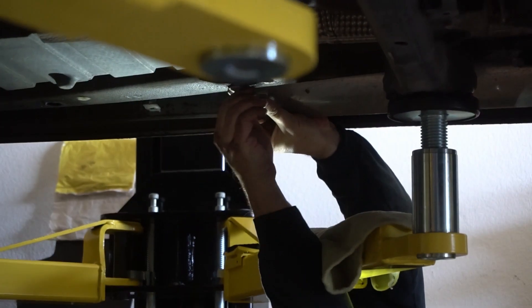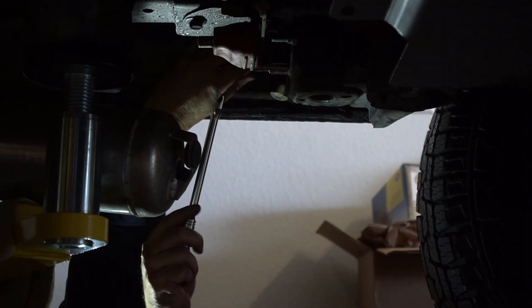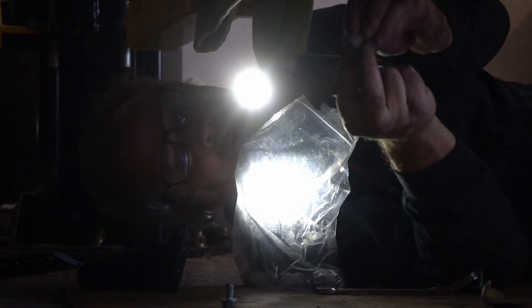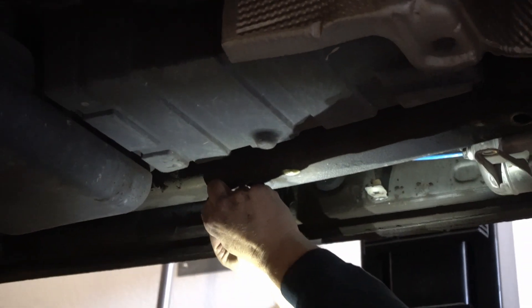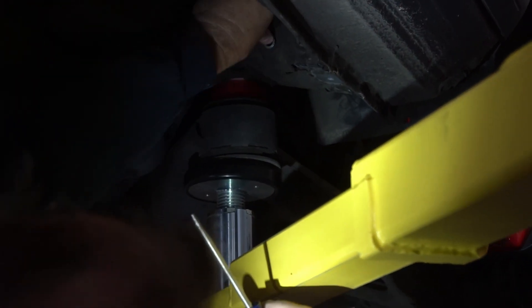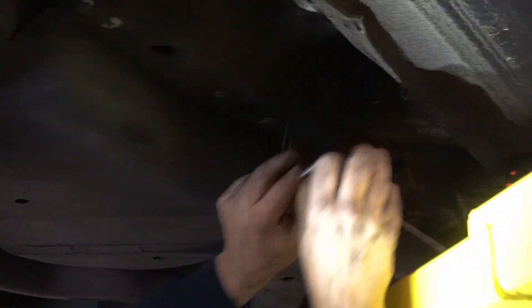Next, we're going to go to the middle where there are a couple of places for this bracket. This piece here has a bolt pattern that's built to go up into a stamp in the frame. On the inside there's a collar, and inside that are threads — so what this does is take a hole and create threads inside it. We'll just tap that. The nuts are in — one, two, three — and we test fit the bracket. These are the two holes we'll have access to, and the bracket goes up in here just like so. Test fit works.